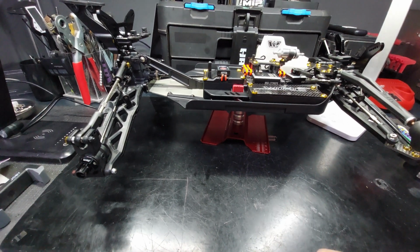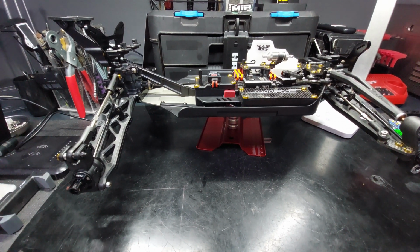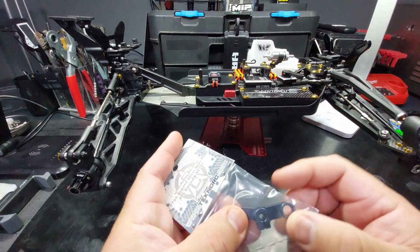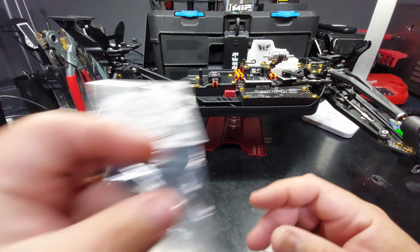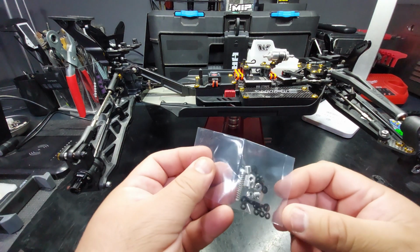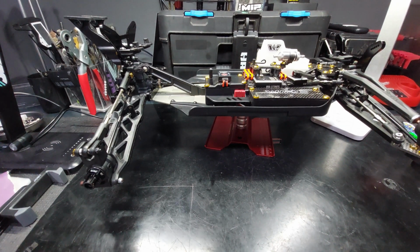In passing, I remember before Marco Barufalo left to join Kyosho, I reached out to him via Instant Messenger and asked him what he was running in place of the plastic piece, and he said he was running the Techno, which I suspected. Having kind of zoomed in on one of his photos, you can kind of tell. So I'm going to follow suit and use the Techno servo horn, and obviously the parts that go with that, which is the bearings and the collars or the inserts, and the actual throttle linkage assembly, right? So I'll put the parts in the description if anybody else wants to try it. I ended up trying it on the Nitro buggy, and I never had any more issues.